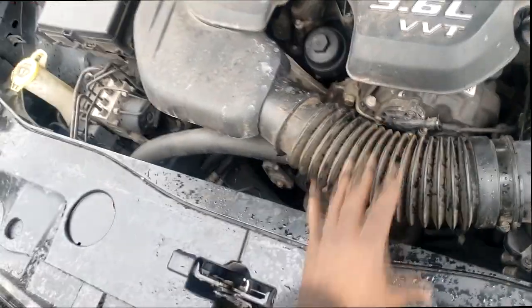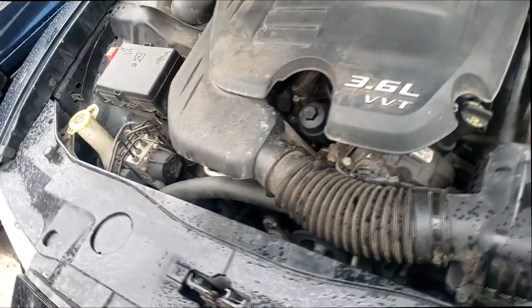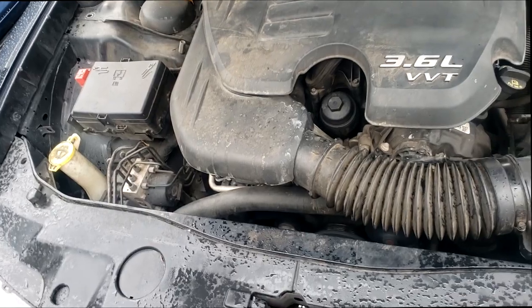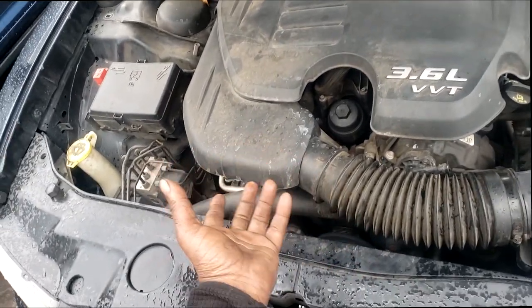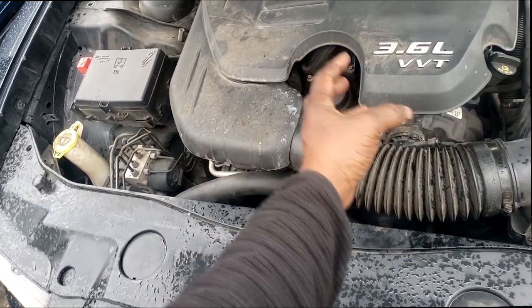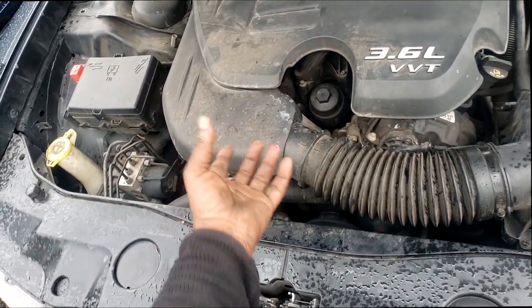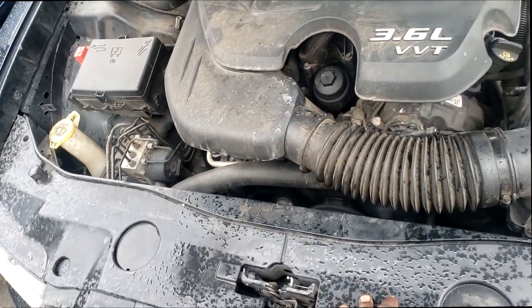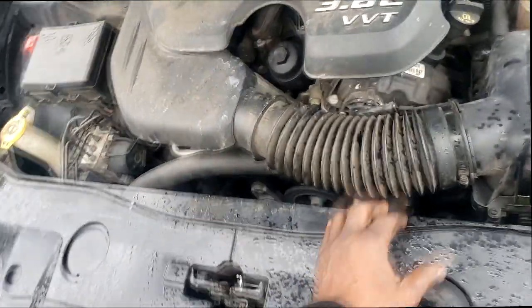Yes, guys, I'm almost willing to bet you it's an air pocket. You don't just magically start overheating after the cooling system has been disrupted unless you did not complete the cooling system repair in the form of bleeding the system, getting all the air pockets out. All right, let's take it in the shop, guys, see what we got. Y'all ready? Let's get it.